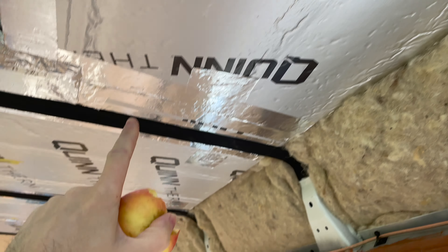First we have to shore up around the MaxxAir vent - we've got a gap of about one and a half centimeters so I'm going to make up some strips from scrap wood to make a square to go in and around it, just to pack it out. When we screw up into the frame of the MaxxAir for the roof we don't want it to be uneven, and we're also going to use that edge to route around, so it's important we do that now. Step one was to measure it to width - 1100mm - then cut the various shapes out, with hole saws for the cables, and an oversized hole at this end for the MaxxAir.